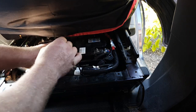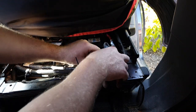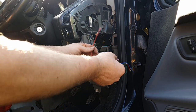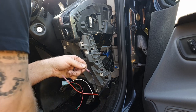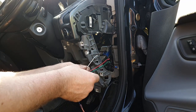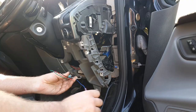We're done in the battery area - just come back to put the fuse in when we're done. Make sure the fuse holder is in an easy-to-reach place - the last thing you want is to struggle finding your fuse if there's a problem. Back at the dash, the red wire goes to the horn and the black wire goes to our switch as the switched earth. When we earth that wire out it earths the relay.